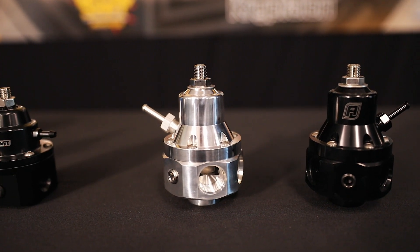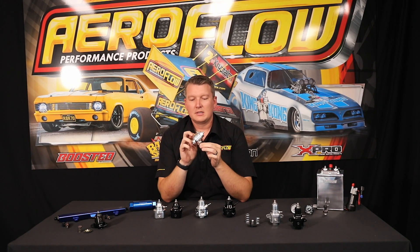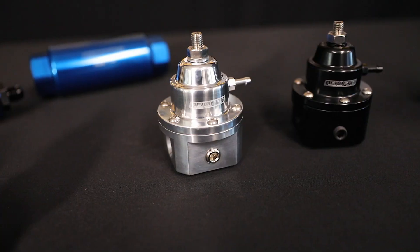Starting with the smaller of the options, this is the three-port regulator. It has an inlet, an outlet, and a return on the bottom. These are dash 6 ORB inlets and outlets, and the return is also a dash 6 ORB, so you can fit your adapter fittings and AN lines wherever you need to go. This reg is rated to around 800 flywheel horsepower, basically because of the body size and the flow it's capable of. The larger the fuel system and the larger the engine, the larger the body and port size you'll want. 800 horsepower is easily achievable with this.